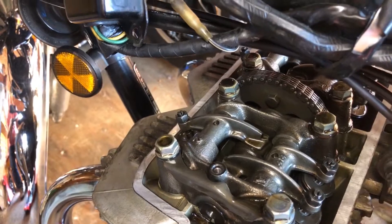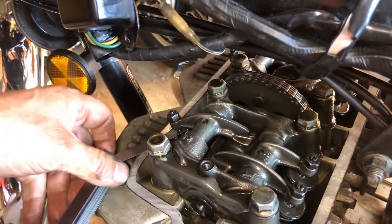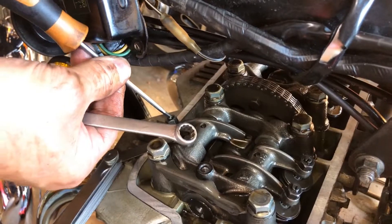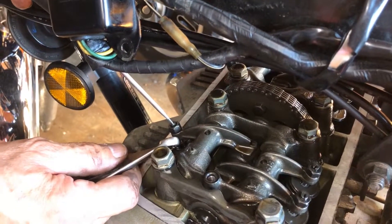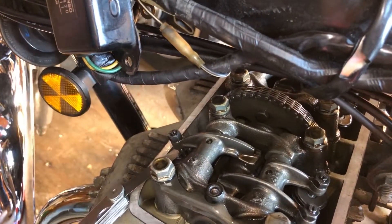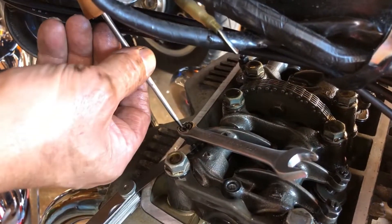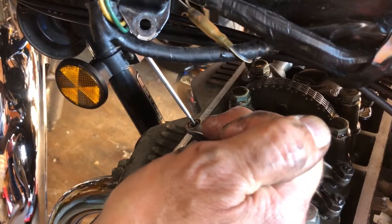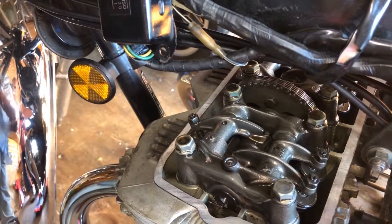So what we're going to do is I'll get a 10mm spanner. I'll just loosen it up a little bit. Slide them in there like that. And then I always back off the nut a little bit and then I will pinch it slightly with the screwdriver until it's about there — it just needs to be sliding just gently. And then all you do — make sure you hold the screwdriver into place, don't let that go — and then just pinch that up nice and firm. Don't over tighten. And that's it, that's all you do. Your tappet's done.